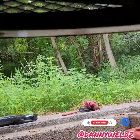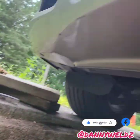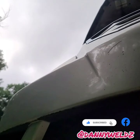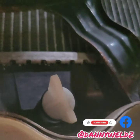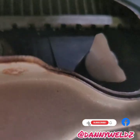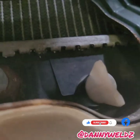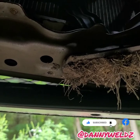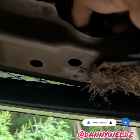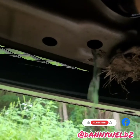While we're down here we might as well drain the coolant. As you can see, this is the front bumper right here that we're underneath, and if you look right under there, that's the drain plug. You just twist it to the left — righty tighty, lefty loosey — and hold the bucket underneath. Hopefully this isn't too crazy; there shouldn't be much coolant in there to begin with.